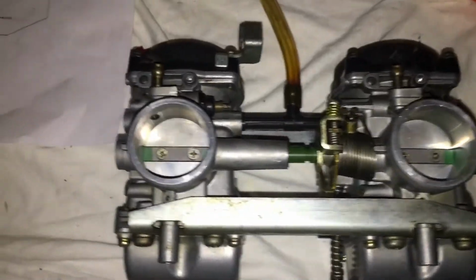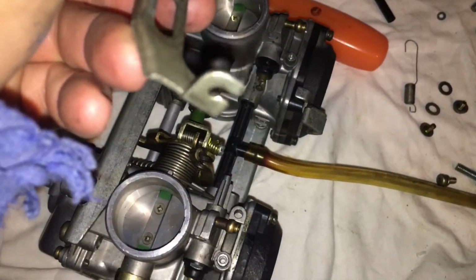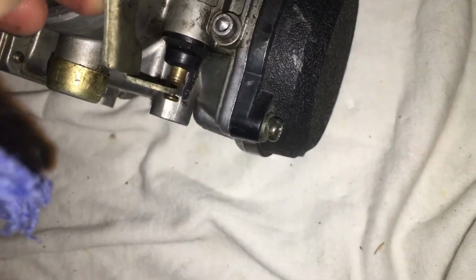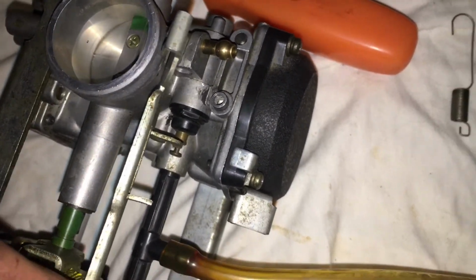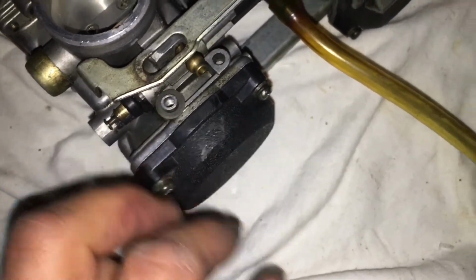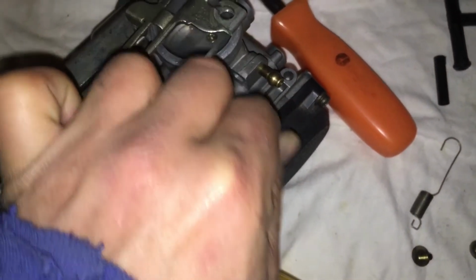Beyond that, two carburetors are pretty easy to sync. Now, let's get this choke cable on, minus the spring because I have no idea how that goes on. From the diagram, you want this little hook here and this little hook here to slip over the choke knob there, and on the same side on the other one. So that's going to slip on there. I need to put down my nylon washer first. Nylon washer on this one. Okay, that's in place. Nylon washer on this one. This is so they slide pretty easily.